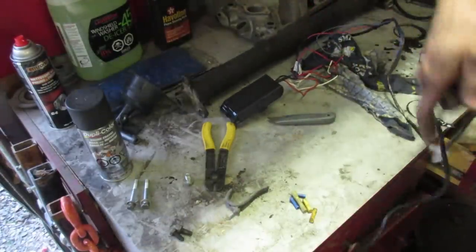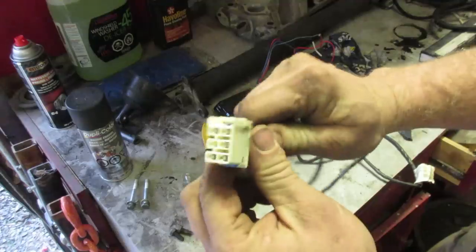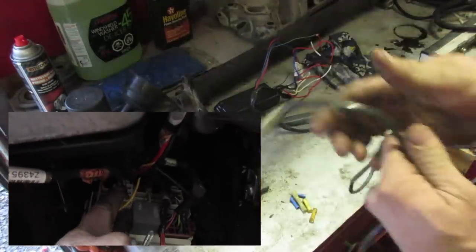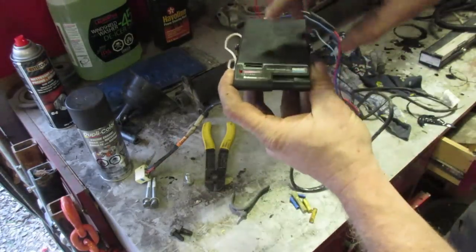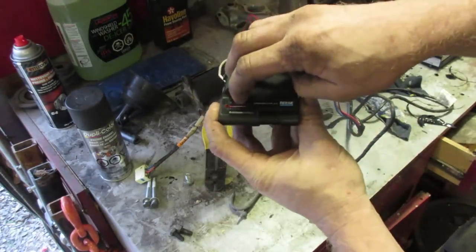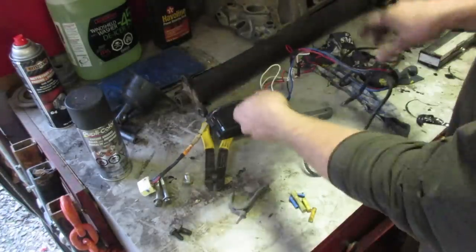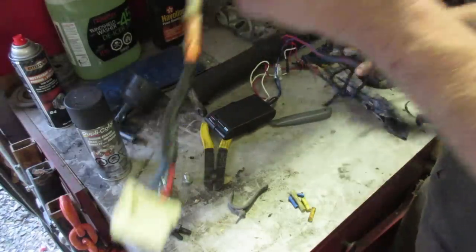What you need is — the truck is already pre-wired, but you need this plug that plugs into the fuse panel by your left foot up underneath the dash there. A brake controller controls how much electric brakes goes to your trailer. The best thing to do is go to a wrecker and grab one — nice and cheap, probably sell it to you for five bucks.